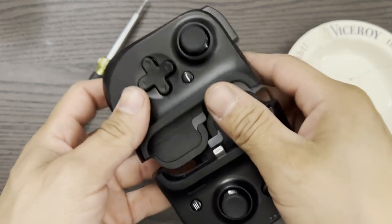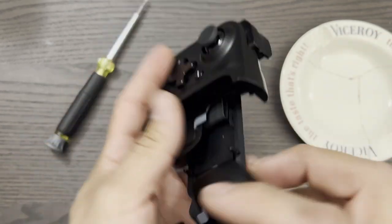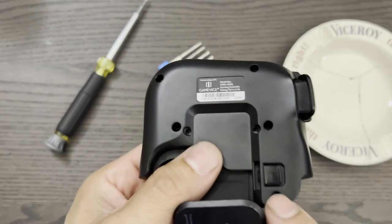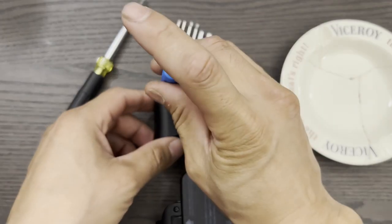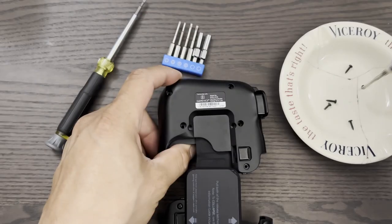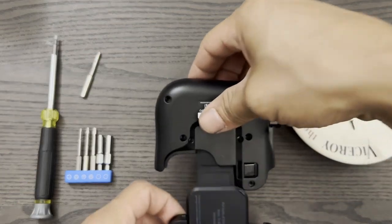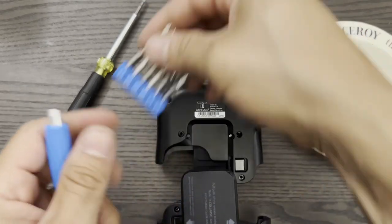Separate the Kishi, and then click the left side back into the back plate so it's not flopping around while you're working. Flip it over and unscrew the five tri-wing screws. Once you have those five screws out, flip the Kishi around and go ahead and set it down. Now we're going to switch from the tri-wing tip to the Phillips tip.